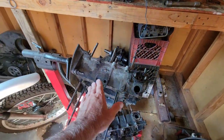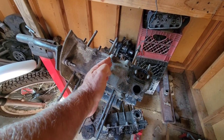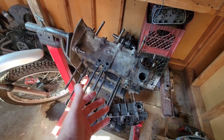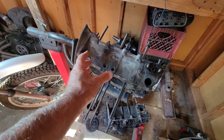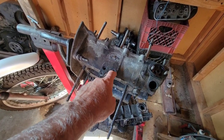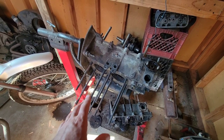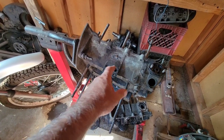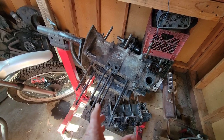Let's talk about them one at a time. If you see the top of your engine — say right where your fan shroud is — and you start to see oil coming around there with a lot of dripping on the ground, most of the time that is the seals for the oil cooler. Sometimes every once in a while the oil cooler cracks, but usually it's the oil cooler seals that get rock hard and just start to leak. I think there are three different types: green ones, red ones, and black o-ring style little rubber sleeves.